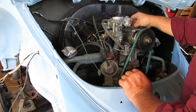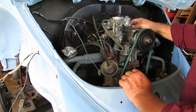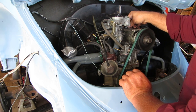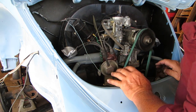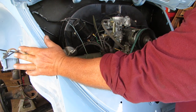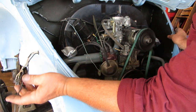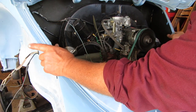And then I have my backup lights, have them secured on this, and I have both my generator attached here and here, and I think I'm going to put a little loop of sorts, and I'm going to attach it to the screw back here. This is originally a kind of a ground screw, but I'm going to attach the wires so they don't move around so much. So that's what we're going to do under here so far. We're pretty good. We have our wires for our tail lights and our reverse lights. We'll have to put a connection on there. That's not going to be a problem.